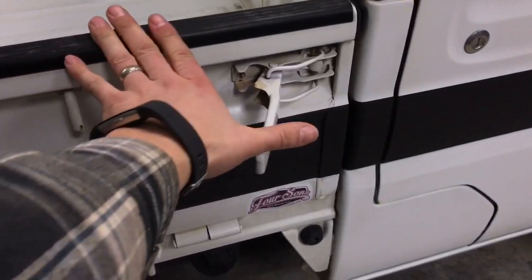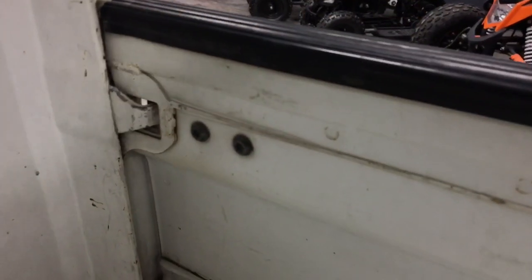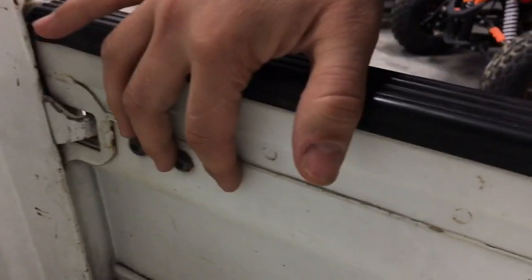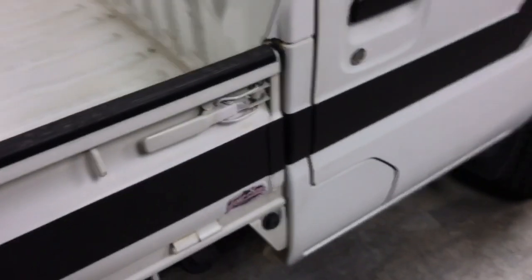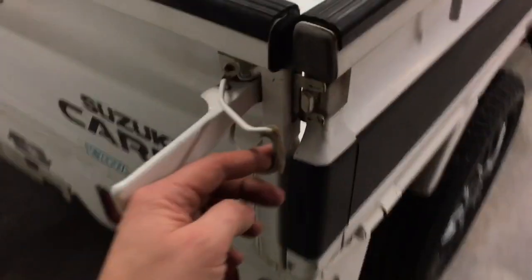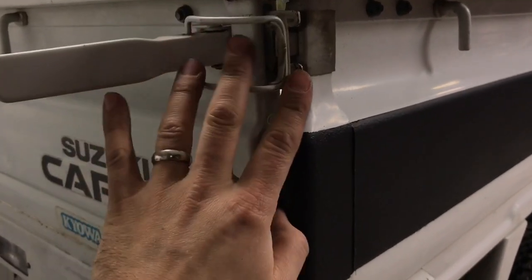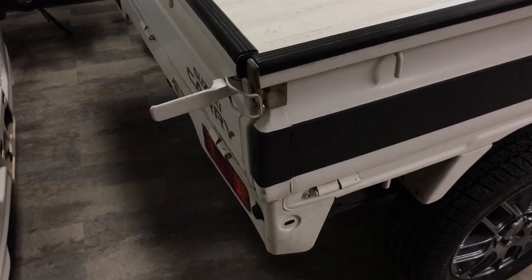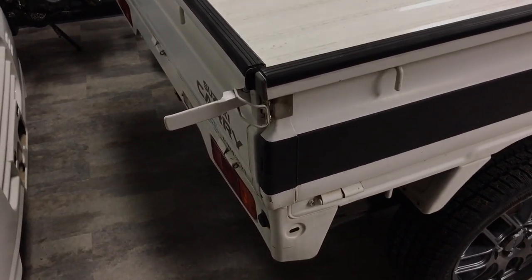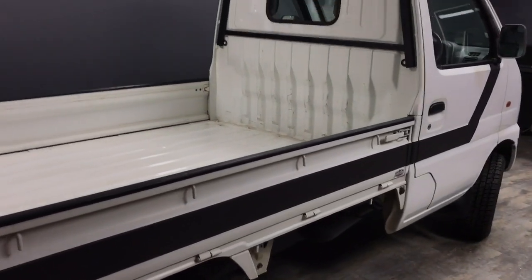One other thing with these bed latches is they are adjustable — there are a couple of bolts on the inside that are slotted, so you can tighten up your bed latches if they are noisy, squeaking, or rattly. If your bed latches tend to be squeaky, tightening them helps, but the other fix is the plastic sleeve on the end — that is stock. The truck is supposed to have that, so if you're missing it, that will often cause high-pitched squeaks and rattles. You can get replacements, and I highly recommend doing that if your truck is squeaky or the side latches keep popping open.